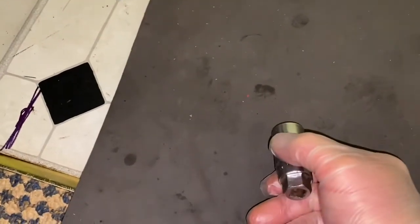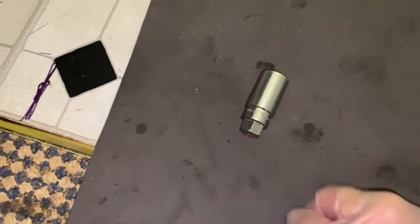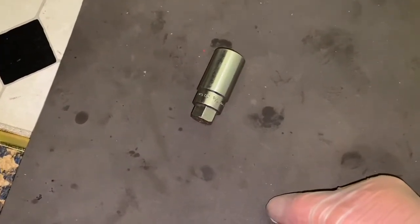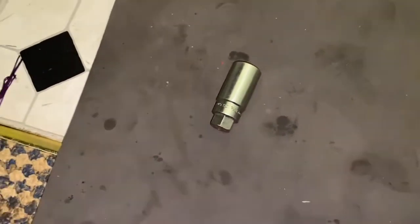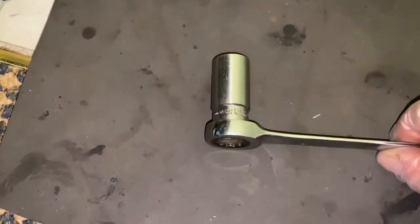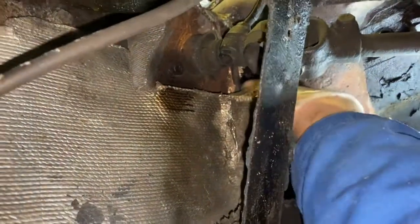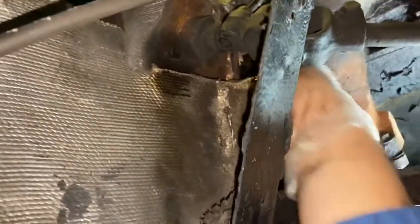It is possible, obviously, because you guys all do it. I had to attach this first on spark plug number eight — push that on first. I couldn't get the ordinary ratchet three-eighths drive in there, so I had to use a spanner to do it. On the spark plug, it looks like that. And of course, it all has to be done by feel through there.